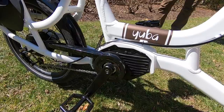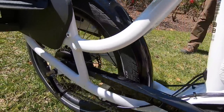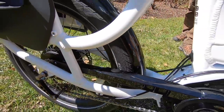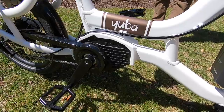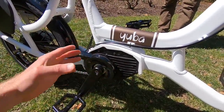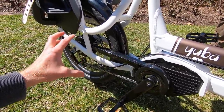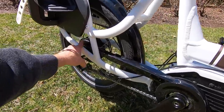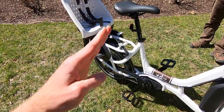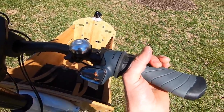The narrow-wide chainring means no chain slip or kickback — something usually only seen on mountain bikes. The Bosch motor measures rear wheel speed via a magnet on the spoke, plus pedal cadence and pedal torque over a thousand times per second. It's very responsive, measuring the pressure of your pedaling to deliver smooth, dynamic power. It also listens for shifting signals and eases back — that's called shift detection. This is less of an issue with a CVT since there are no abrupt gear cliffs; it's a smooth transition using orbs and a tilt mechanism inside.